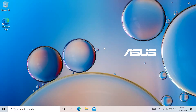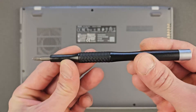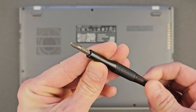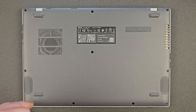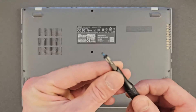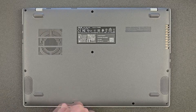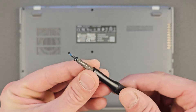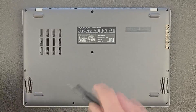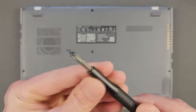Before we open up this laptop, all you need is a standard Phillips screwdriver. I use this 57-in-one — I'll leave the link in the description if you're interested, it's a great little tool. When taking out the screws, keep them separate because they are different sizes — some are shorter, some are longer. Remember where you took them from so you know where to put them back, otherwise you will damage your laptop. Learn from my mistakes, not your own.